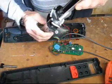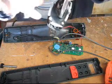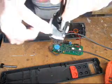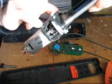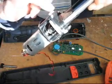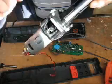What you now need to do is separate the engine from the shaft. There's 4 Phillips head screws. 1, 2, 3, 4. Be very careful because there is also a Phillips head earthing wire on this section here. So when you pull it apart after the screws are off, just hold on to it until you can take that screw there out.